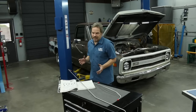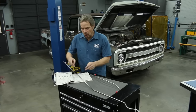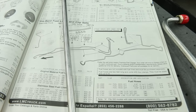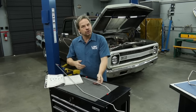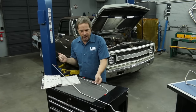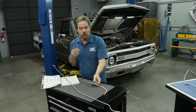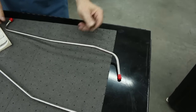We're also going to replace the fuel lines from the tank to the fuel pump and show you some of the options you've got if you're doing this project. One of the things I like most about the LMC Truck catalogs is not only do you get a good description of what's available, but also the exploded diagram showing the orientation of the parts on the vehicle. We've got replacement 5/16" lines, which is what this truck came with from the factory, but the upgrade is that they're stainless steel, so the carbon steel degradation you get with time doesn't happen.